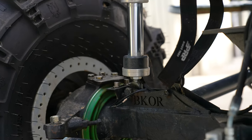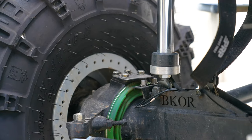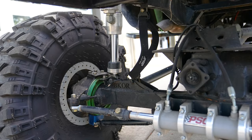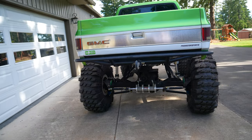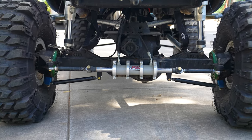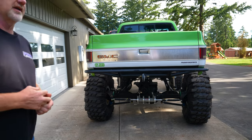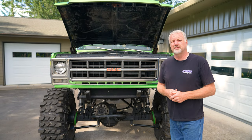Back here you can see the rear steer — same basic kit as what's on the front. On the driver's side you can see the self-centering proximity switches. I got those from Jurassic — they do the monster trucks up in Canada, super nice guys to deal with. At the bottom part of the axles you can see the kingpin supports that we put on it. I wanted to build it so it holds up, as the Rockwells are known for splitting out the knuckles.